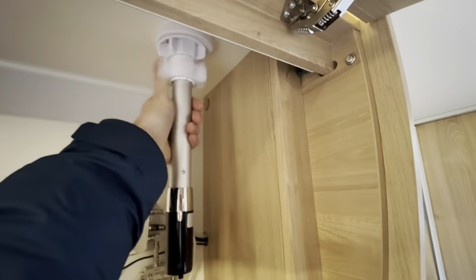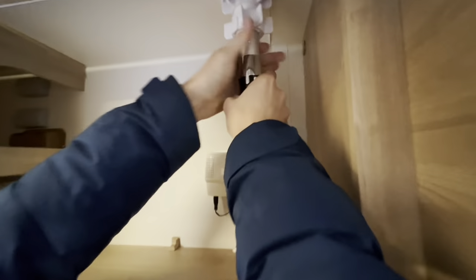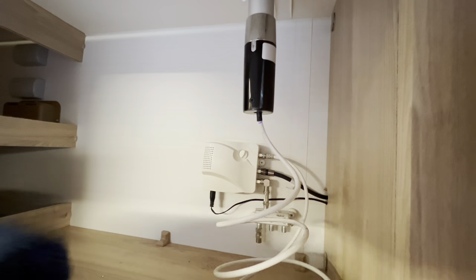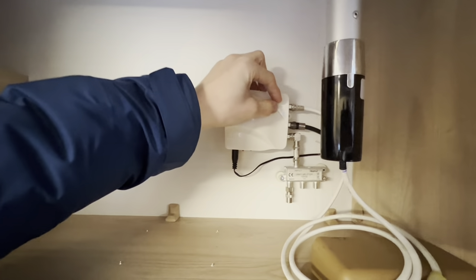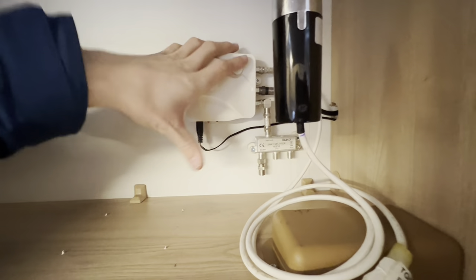Your television aerial is a directional aerial. If you're struggling to get a signal, loosen the nut, push the pole up and tighten the nut to hold it in place, then turn the black collar right round to direct the aerial on the roof. A top tip is to look where other motorhomes and caravans on your site are pointing their aerials. Before driving, this aerial must come back to its normal lowered position — you don't want wind to get underneath it and rip it out of the roof. There's also a tele-booster on here to amplify the signal; try that first on the little wheel before directing the aerial.